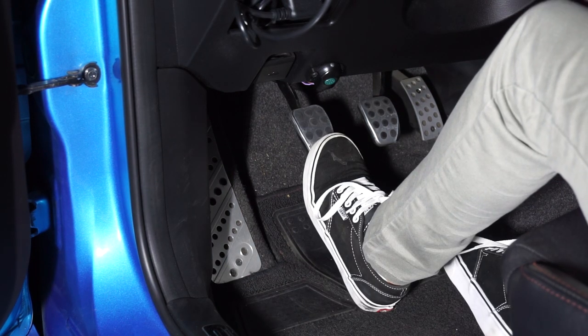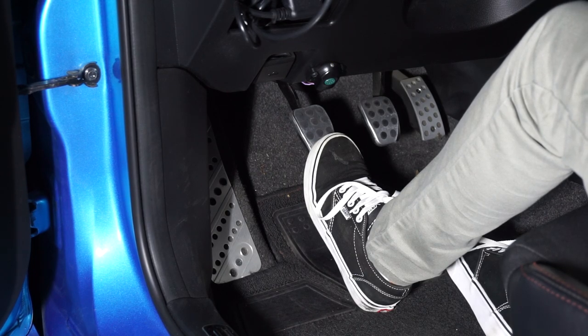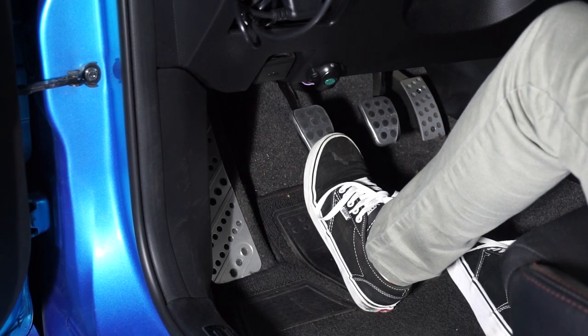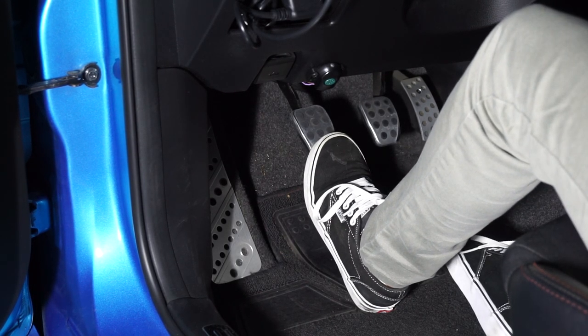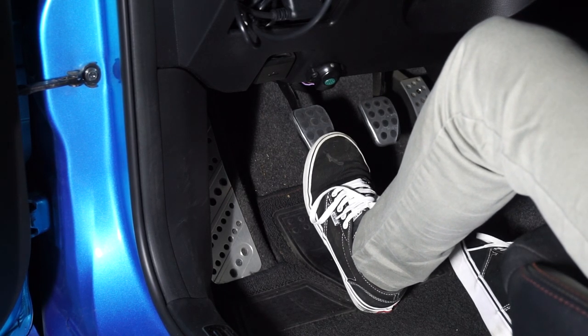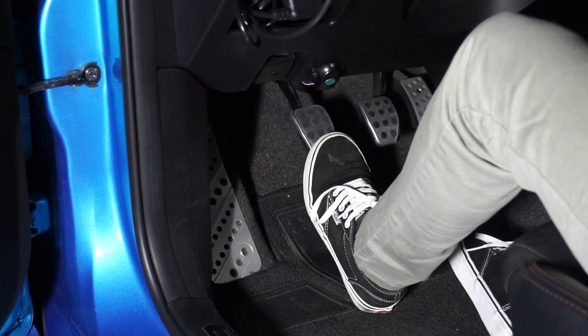For our car in particular, I noticed that it takes more pedal travel before the car will get into gear, particularly in reverse gear. I also noticed that the clutch pedal is touchy and no longer crisp. What I mean by touchy is the point of engagement is harder to find — instead of always knowing at what point the clutch would engage, I now have to modulate my foot a bit to find the correct pressure, which sometimes causes my engagement to be a bit more abrupt.